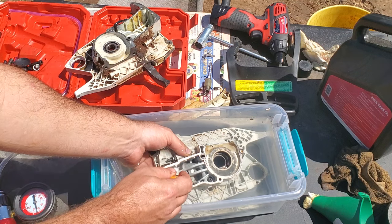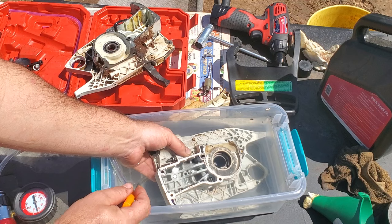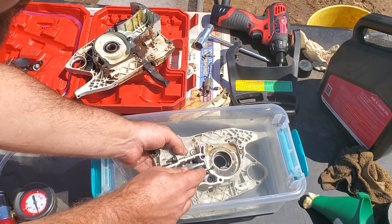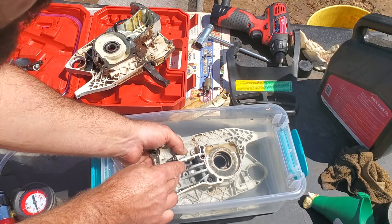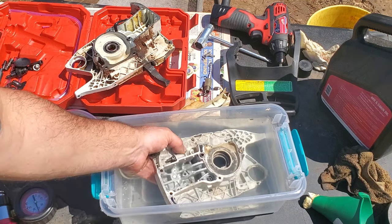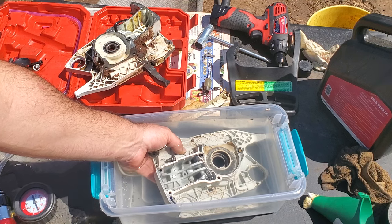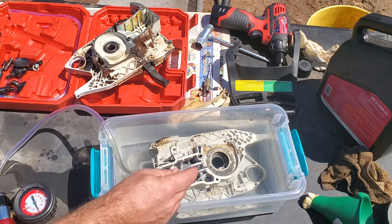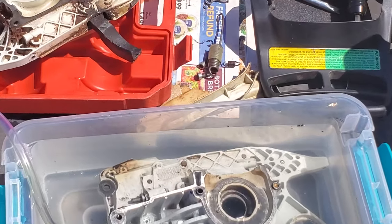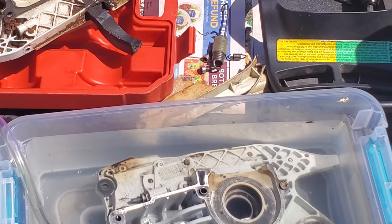There's a micro crack somewhere in there. Now if it was on this side it'd be fine - oil would just be leaking into our channel already. But over here I don't know - there's no way to fix that easily. I could try and force JB Weld down in there somehow, but I don't think I want to do that. There you go - there's your air leak, that tiny little - look how slow those bubbles are coming out. Can you see them neighbors? Give you a good view right there.